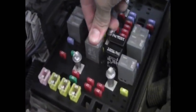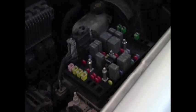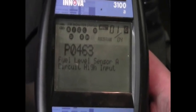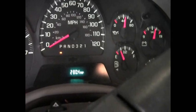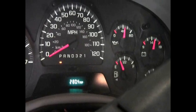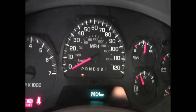Go ahead and put the relay back in the fuel pump. Then try to start the vehicle — it might take a little bit. Prime the pump a few times by turning the ignition key to the on position and back off several times. I cleared all the codes — they're all gone. Got the truck started right away with the new fuel pump. My gas gauge looks like it's working. We ran it down to only a few gallons and it looks like we're at a quarter tank. Check engine light hasn't come on — if it does I'll update you.